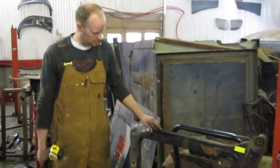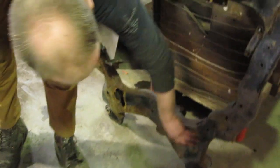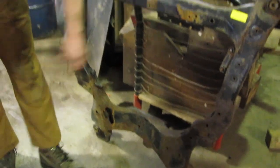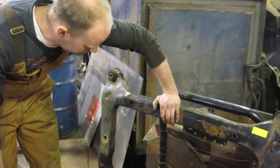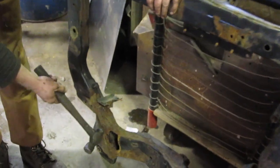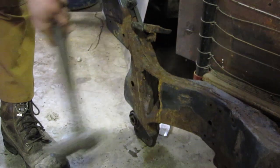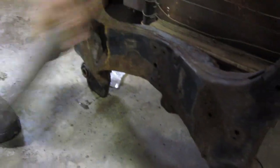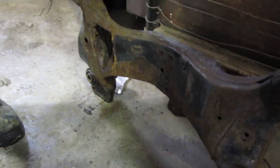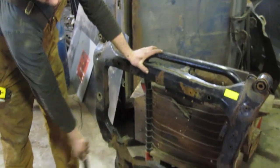Now this was a common problem. The frame looks good enough all the way around — you can see where things are bolted on, it's a little rusty here and there. This is Canada, we get a lot of salt on the roads. What I didn't know is that the AC condenser and the evaporator leak water in one spot and it rots it from the inside out, whereas the other side is nice and solid. So he brought it to the mechanic who said this is a common problem — he took a hammer and poked a hole in it and said you need a new subframe.